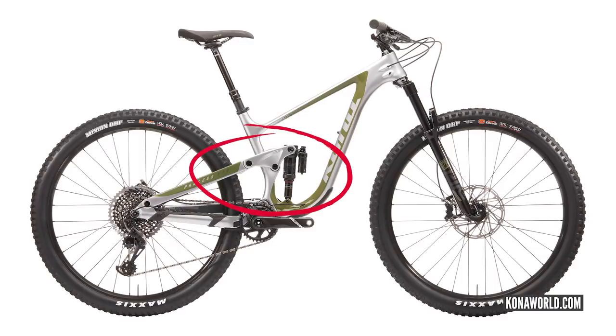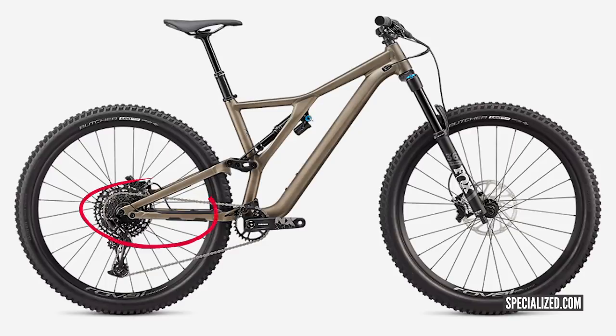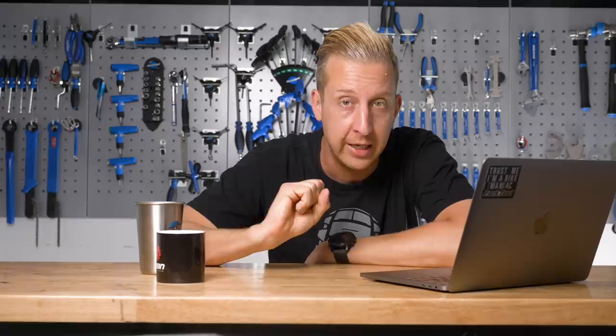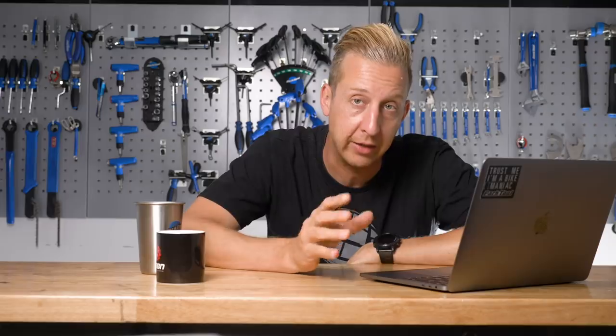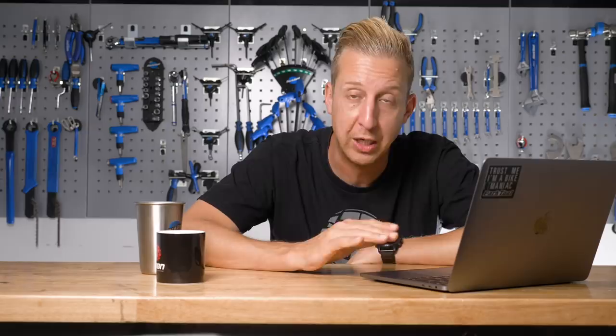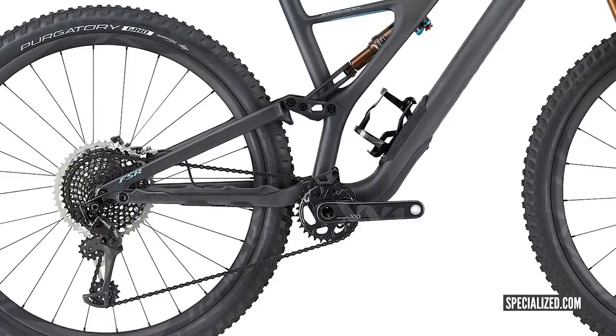Next is the four bar. The example on screen is a classic Specialized Stumpy — the Evo model. The difference between this four bar and the Kona is where the pivot point is: on the chain stay as opposed to on the seat stay. This really does change things dramatically. Braking has little or no effect on the rear suspension in use — that is the major selling point. That pivot was known as the Horst Link, after Horst Leitner, who designed it on early AMP research bikes and licensed it to Specialized, who called it the FSR Link. It's the most common design ever used, still used today by Specialized, Cube, and many other brands. When all those pivot points are oriented exactly right, it can be the best suspension platform out there.